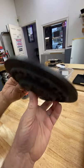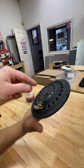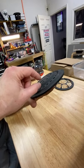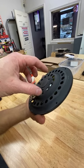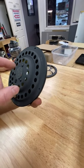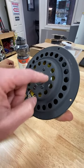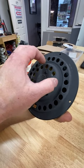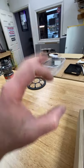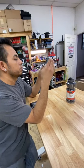They put this plug in the back. It's got some foam. This isn't by accident, this is by design. The density of the foam all plays into the power handling and the design of the magnet structure. It's unique, and the voice coil on this is huge. You see the silver piece here, this is the outside. The voice coil is on the inside of that, so the voice coil is literally this big around. I think it's 2-point-something inches. So it's huge.